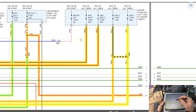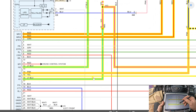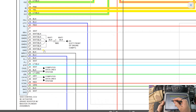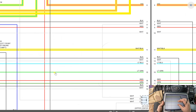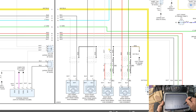ABS 1 fuse — both ABS 1 and 2 are hot at all times. The big ones are also hot at all times. Then there are just two ignition fuses — that's a lot of power for one module. Then we've got grounds — a bunch of grounds. They all ground on A3, and there's another ground here that grounds to the left front of the engine compartment, A2.